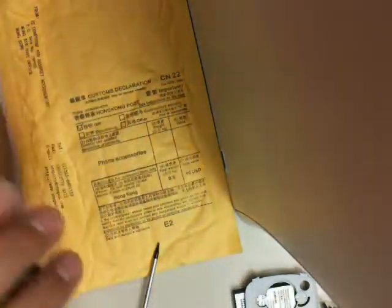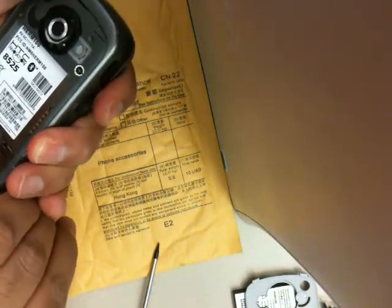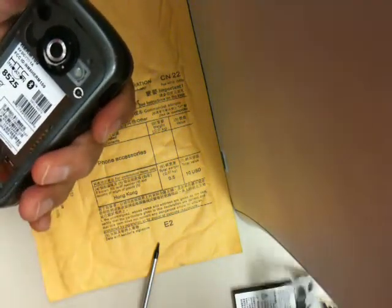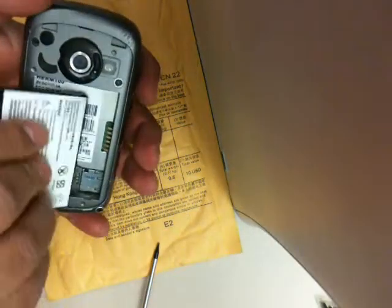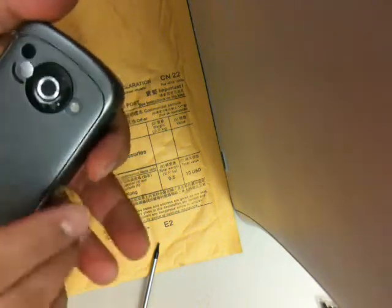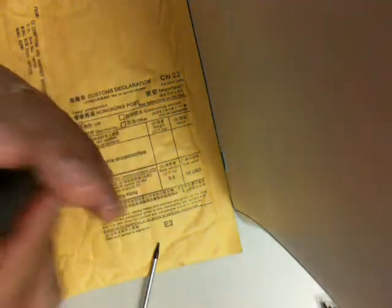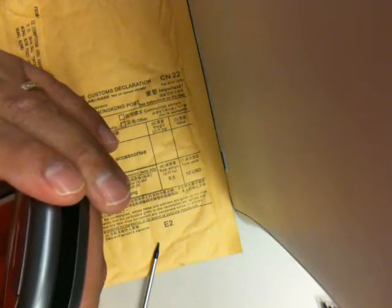Once this is done, you can then make sure that the keypad is seated properly, and as you can see here, it looks brand new. Go ahead and you're going to want to reinsert the battery, and then you will want to reinsert the battery housing cover, and then from here you will power on the device, and then we move on to testing.